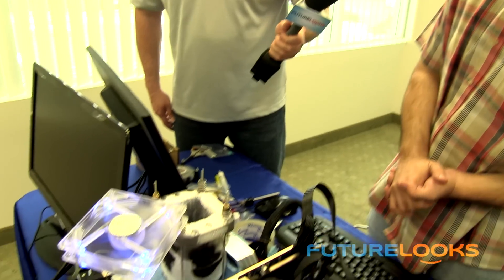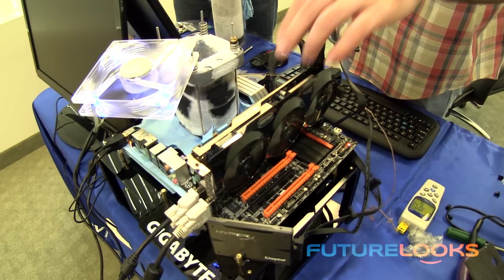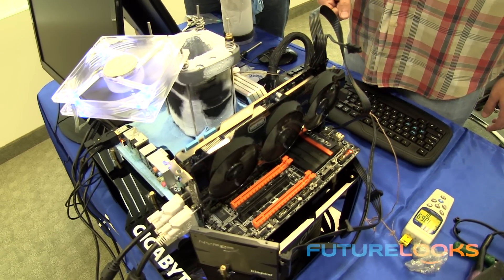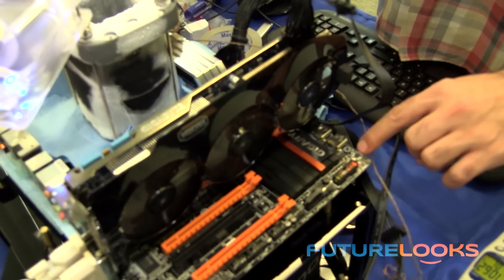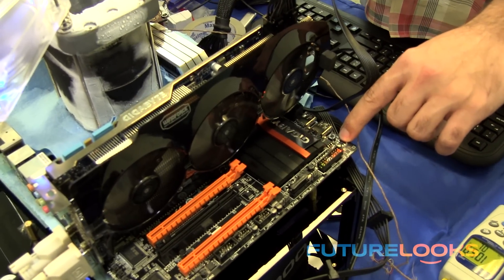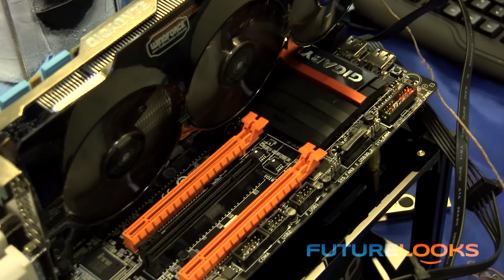This feature actually took a lot of engineering to develop — supposedly very hard because the CPU isn't on. So I just press the on button and the system comes right back on. I've also disabled some of the other slots — slots 1, 3, and 4, which are the orange ones — so I don't have to insulate inside those slots. Now let's say I need to clear the battery and do a full CMOS reset. Clear CMOS is over here, but I can press this button called CBAT. CBAT will basically clear the memory as if the battery was removed and you pressed clear CMOS — excellent if you have four GPUs installed and want to troubleshoot without removing the battery or your GPUs.